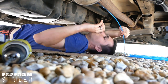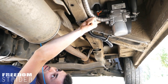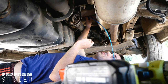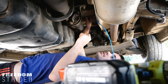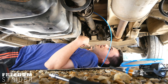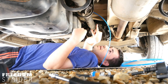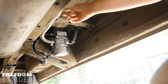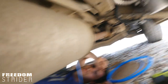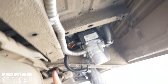Under the van, we've got our blue fuel line and it needs to connect to the fuel port on the furnace. We've got it coming out over the drive shaft. We need to fit the fuel pump and the fuel filter onto something before it gets to the furnace. They have to be at least 50 centimetres apart. My concern with one location is it's quite near the exhaust — both the van's and the furnace's.